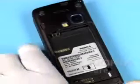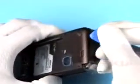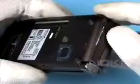Release this clip of the antenna cover with the SRT6 first. Now release the two clips on the side of the assembly. Release the clip located on the edge. Now the antenna cover can be removed easily.